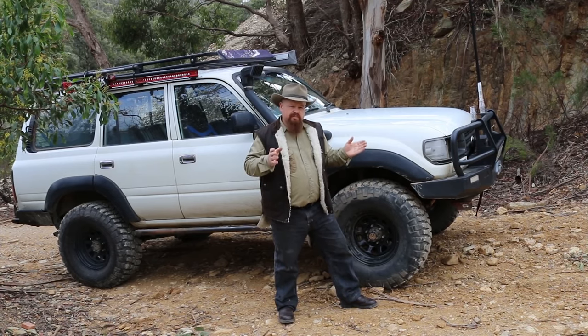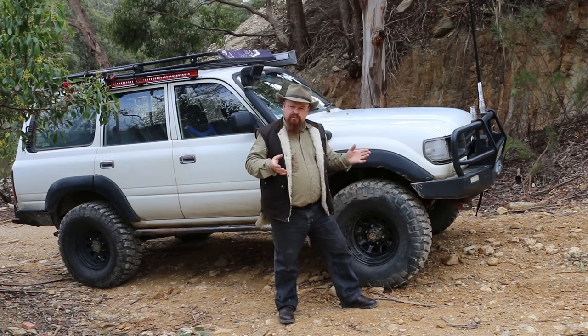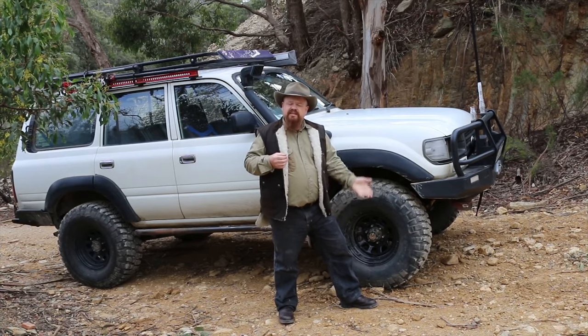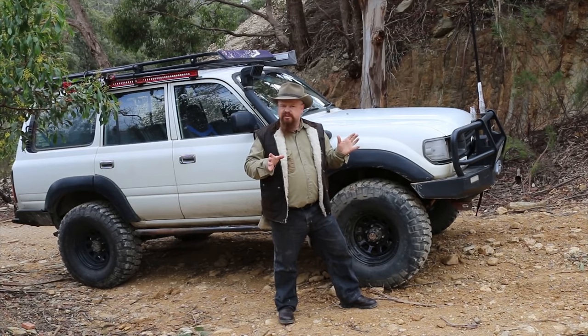This is the only time in a manual vehicle, while you're stopped and secured, that you touch the clutch. I like to refer to it as angel gear - once you've got the clutch disengaged you're going to need an angel. While stopped and secured, slowly press the clutch, select reverse, and then take your foot off the clutch. That's the very last time you have to touch the clutch to reach the bottom of the hill.